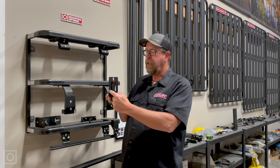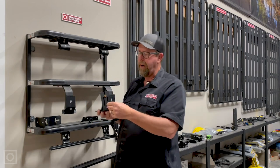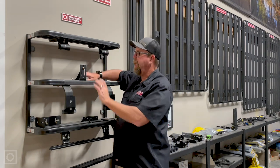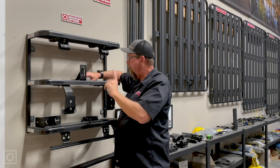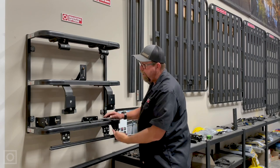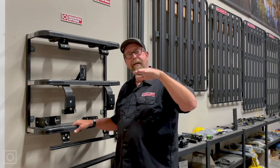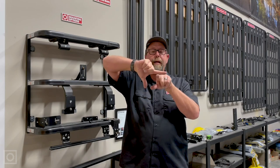This awning mount matches the back surface of the awning, allowing you to mount that bracket and adjust it height-wise. The bracket sits on top of the rack system, which allows the awning to be elevated above the roof rack for added height if your vehicle's roof is rather low. The other option is to mount it downward, where the bracket goes down and the diagonal back brace sits between the first slat and the side of the roof rack, keeping the top flush — very handy if you're adding a rooftop tent and need that extra surface space.